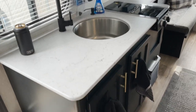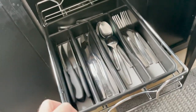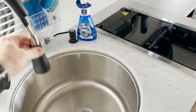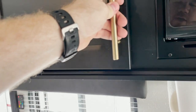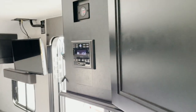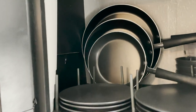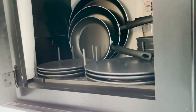I have a 24-inch and a 32-inch TV with Amazon Fire Sticks installed. Moving to the kitchen area: in the lower cabinets I put in a pull-out drawer rack for utensils, which has been super helpful. The kitchen sink faucet I replaced with a retractable one because the original was rigid and got water everywhere. In the cabinet above the sink, I cleaned up the wires behind the panel and cut the panel down to push it back, giving me more room for pots, pans, plates, and bowls.